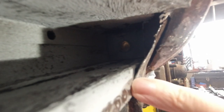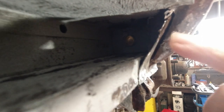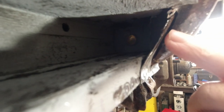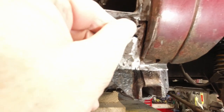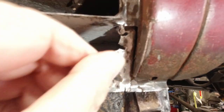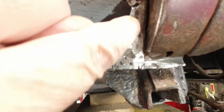So again, if you look down here, you can see the thickness, and then up here it's gone really light, all the way to the top. So what I'll do is I'll cut here, cut down here. Now, to do this repair, we have to stay out. You see the change of colour there? There's like dark in at the back. So if I just put my disc down there, about 4 mil out from the corner, okay?